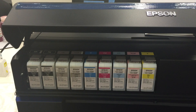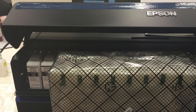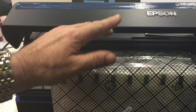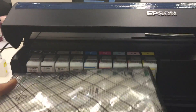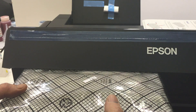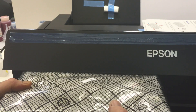In addition to the Chinese refillable carts, we're also going to have our damper cartridges. Unlike our previous versions of the 3880 and 3800 damper cartridges, these have a chip on every single position. They'll reset when it says it's out of ink. There will be a switch key in this package. The cover will stay open about that far when these are installed because they are 100 milliliter carts — actually 120. I don't like putting 120 in them, I like to put 100.